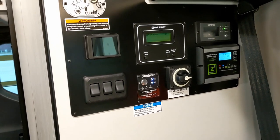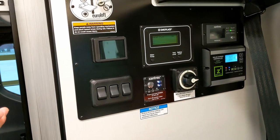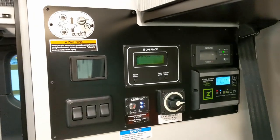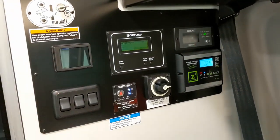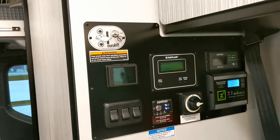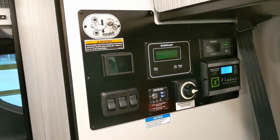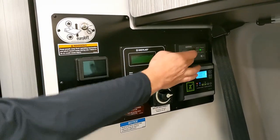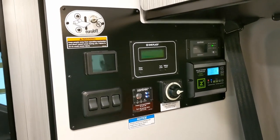When it reads zero you're really at 10%, so it won't harm the batteries — it actually shuts down at that point with the reserve intact. The dude who left everything on didn't get enough solar to keep up with his heater and it just killed it. That can take a couple of days depending on what's running. The AC can kill it in about 6 hours. When that happened in testing, they shut the inverter off, powered the batteries back up, fired the engine, and everything stayed on as the alternator started charging.